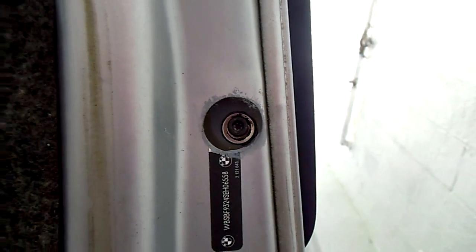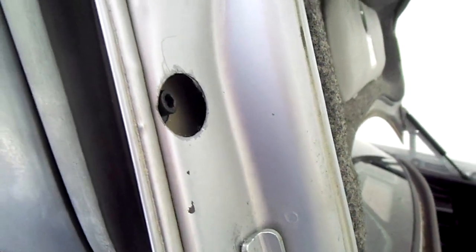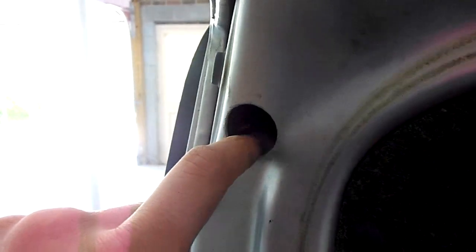This is a follow-up of the E36 GT or lightweight eBay special spoiler install. Alright, so a little bit about the install. It's not bad. So what you use is a 1-inch hole saw. And I used M6 by 1.0 hardware, different lengths front and back. This was an M6 1.0 times 60 or 70 millimeter. And this right here was like a 40 or 50 millimeter.